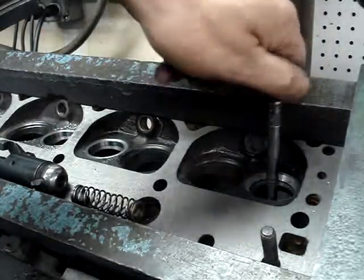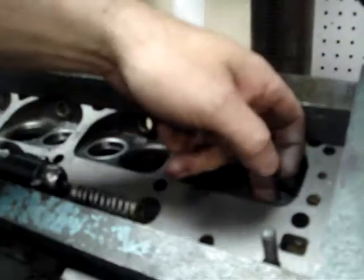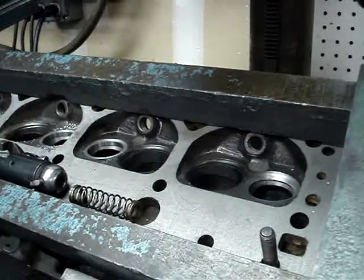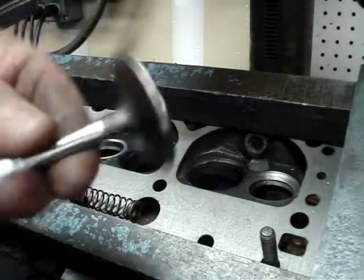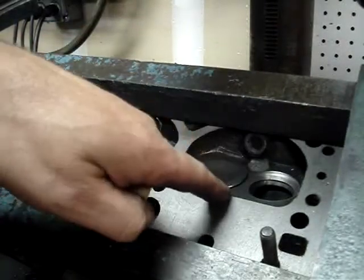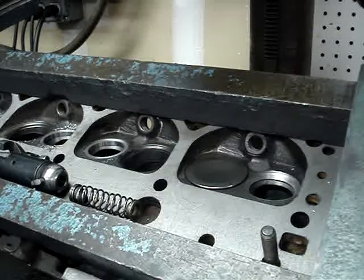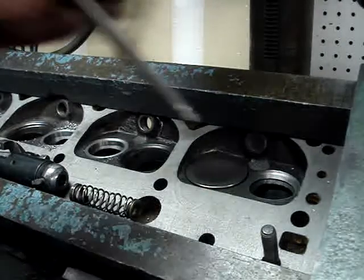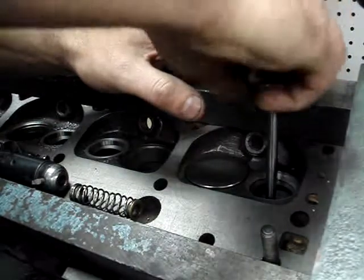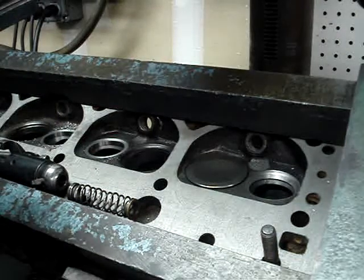So now that seat is ready to accept the valve that goes in there. We're actually putting larger valves in this head than it had originally, so we're making the valve sizes larger because we want to get a little better breathing out of this engine. We're also going to put a larger intake valve in. This is our intake valve that's going in there, so we're going to have to modify this intake seat because you can see how far that's sticking up — that seat is not compatible there. Our exhaust seat, however, is finished and is ready to accept our exhaust valve. We put new guides in here and there's a little bit of debris in here so I'm going to have to clean that out before I get this guide in.